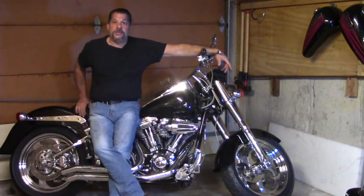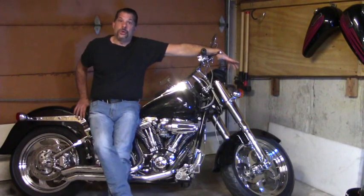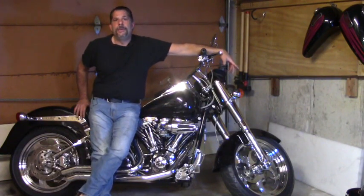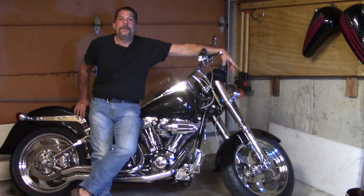Don't just keep replacing fuses. They're costly, but what you're doing is you're torturing the component that is shorted out. Take your time, hunt down the problem. You'll be real proud of yourself when you find it. And I can assure you, it's looking right at you somewhere.